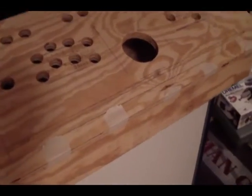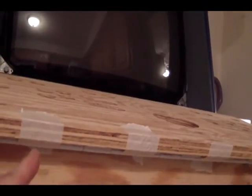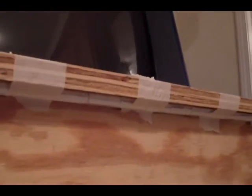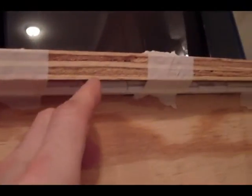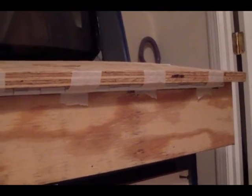Okay guys, I took some masking tape and I taped around the top of the control panel and down onto the hinge there, and it's going to keep the hinge from moving any towards the inside. If I pull this top off and kind of hold the hinge and then just lift it up and tilt it, as long as I don't let the hinge come forward this way with the top panel, and I just let it lay back against that way, it's not going to move at all because I've got it taped at multiple locations. And I put pencil marks to the side of the hinge and all across here so I can line it back up if I need to. But I really don't want it to move at all because it's in a perfect location right now. So we're going to pick the control panel top up